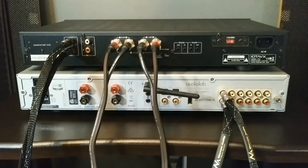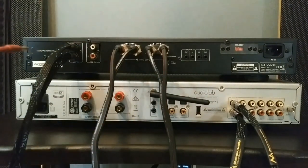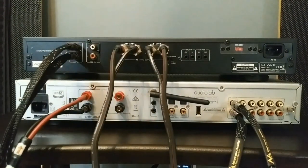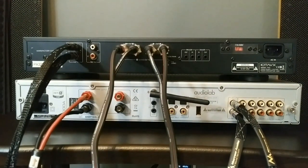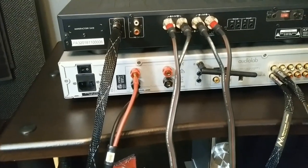So now we're actually going to be using the Audiolab 6000A to drive the high frequencies of the T-sound speakers — the tweeter. I'm going to get the left side high frequencies and plug them up to the Audiolab — negative, positive. These are actually my Clarity cables, very budget cables, about a hundred bucks, and they work great. Now we're going to go to the left side speaker and hook up the high frequencies. As you can see, this speaker is now bi-amped. We only have one more left for the right side high frequencies.